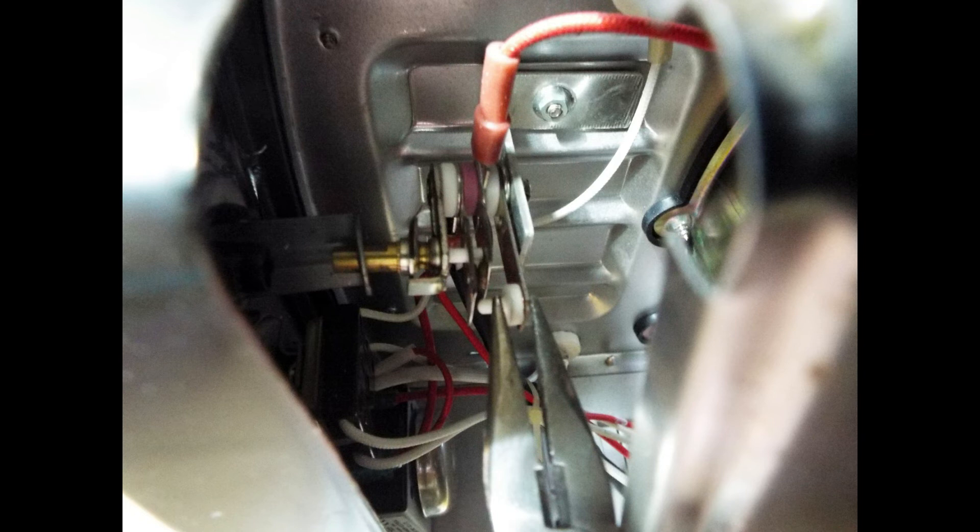I got it within 10 degrees of my 360. Then what you do is turn it all the way down and read it, turn it all the way up and read it. In this case, I cannot get the maximum they advertise of 450 — I get about 430, at least on my temperature gauge that's in the oven. But that is good enough, so with it all put back together, we now have a countertop toaster oven big enough to put a pizza in. I know the EuroPros are old, but as long as they still function, they work as good as a new one.